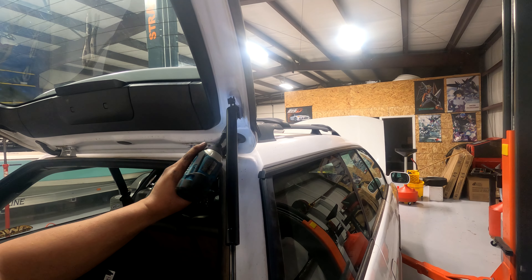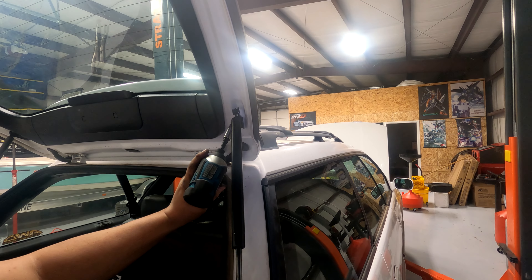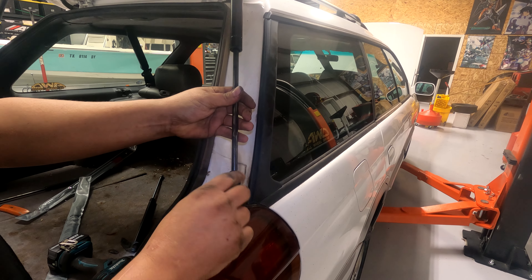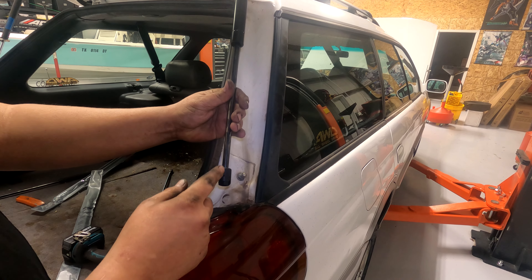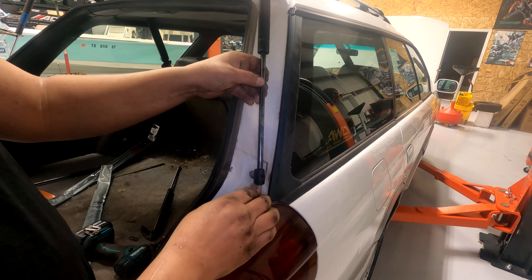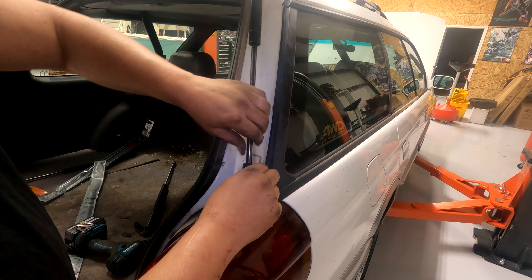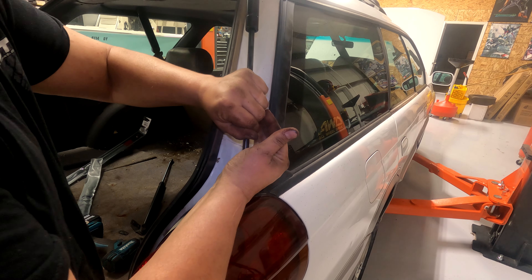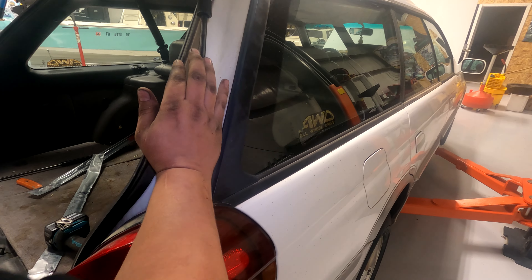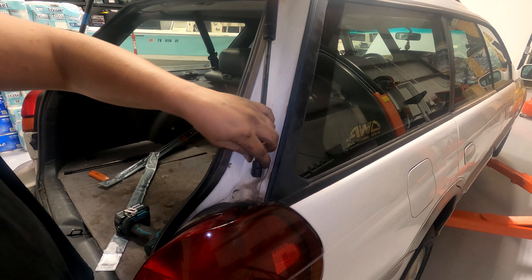Down here you want to turn this thing clockwise if it doesn't line up, because otherwise you'll unscrew the head from the rod. So always turn clockwise — turn it to the same angle as the ball. You don't have to mess with the clip at all; you just lift it, give it a push, and it locks in right away.